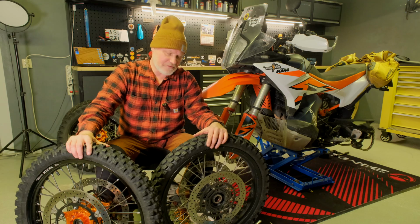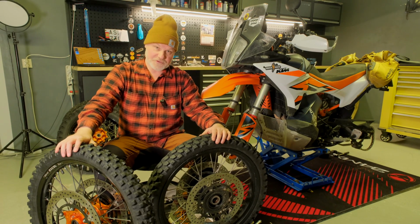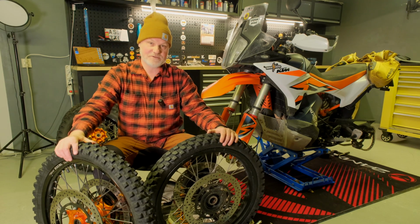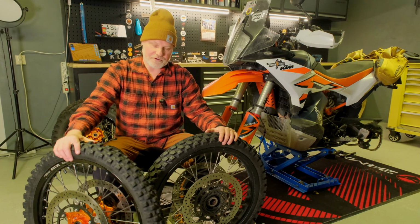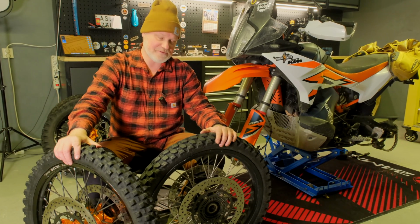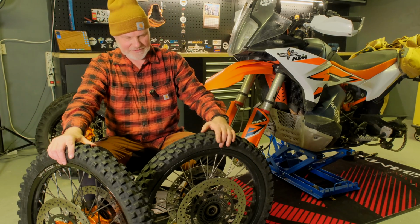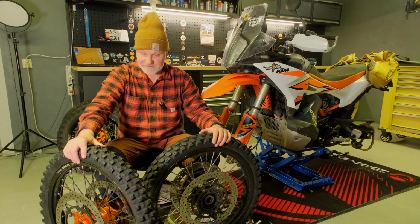But the most interesting thing is actually performance. What will this do with the performance of these two types of dimensions and rims? I should also mention that the original wheel set is tubeless, and the narrow rims are of tube type. I also forgot to mention that I have BIB Mousse in the rear wheel when we weighed them, so there is a lot of variation here to consider, but still that huge weight difference, and that's interesting.